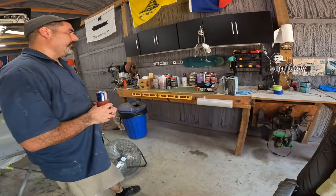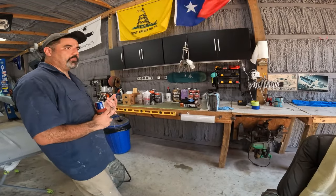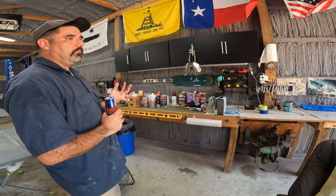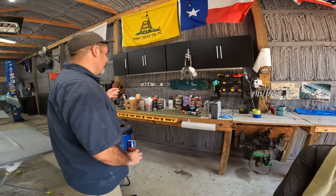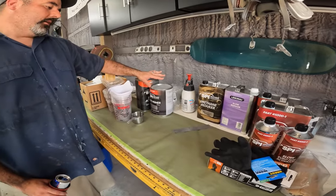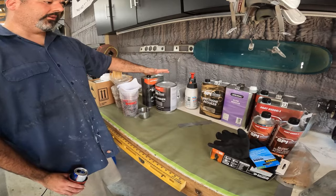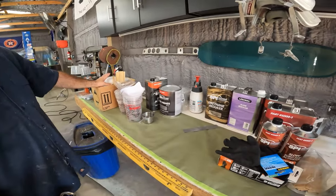All right, so our camera's overheating, but got the station ready. Tomorrow's Sunday. Tomorrow night I'm gonna come in, maybe after it cools off, and we're gonna seal. I'm gonna seal it with epoxy primer. Probably gonna reduce to 25%. Let that sit Sunday night, and then come in and go straight to our color. We got 2 gallons, which I don't think I'm gonna use 2 gallons. I might use one.